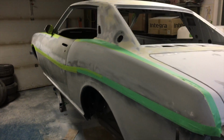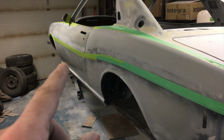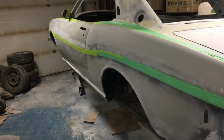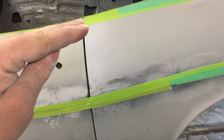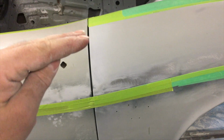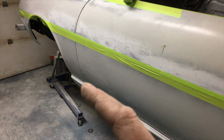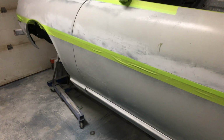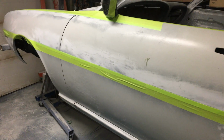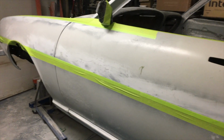So my dad came down and helped me tonight do a door pin. The top one was fine inside this door, but the bottom hinge door pin was shot. It had lots of play, and so what would happen is you would set the door height. If you'd set it even here, and then bolt it tight and let go, it would drop a bunch. So that actually took us. We had to literally use a hacksaw, a drill bit, and a couple other things to get that door pin to go out. I would say it took us a good 2.5 hours just for that one hinge pin. It was so rusted in there, we couldn't get it out even with heat. So that's in there tight.